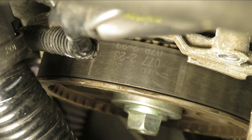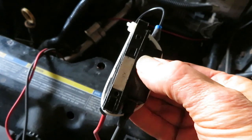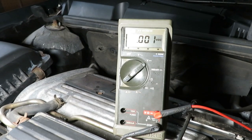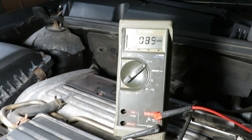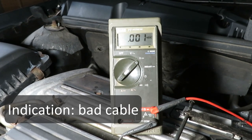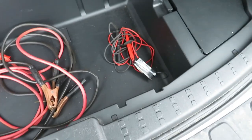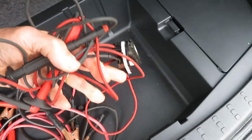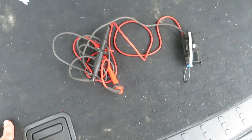This belt is not brand spanking new as the dealer said. This is the remote start switch up on the B plus. This is the voltage drop from the positive lead of the battery to the battery plus on the starter solenoid — we found a bad B plus cable. I find this so useful that I've taken to carrying it with me right alongside the jumper cables. On many cars you may have to pull out an S cable from the starter, but I think it's worth the effort. Thanks for watching and please subscribe for more videos that you might find useful.